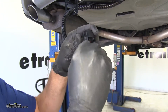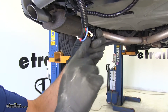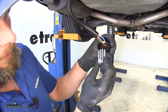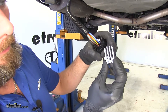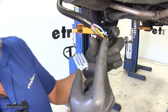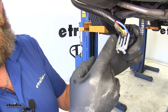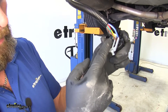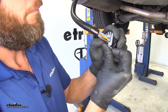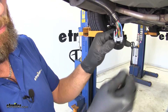The last one we'll put in will be our blue wire. That's going to go - with our tab at the top - right underneath our white. Now we've got our keeper that needs to slide in. The tips here are going to fit in those four openings right here. The blue and brown wire should be on this outside slot, the green and red should be on this outside slot, and the other three should be going right up the middle slot. Once we have that in place, you just push down, and those two tabs are going to hold it for us.